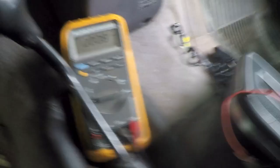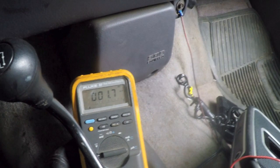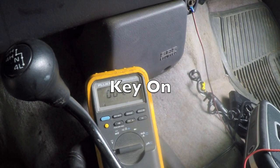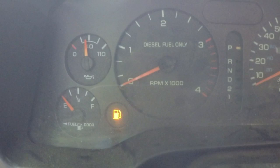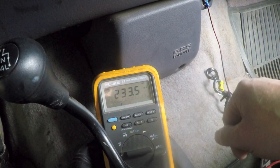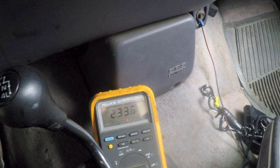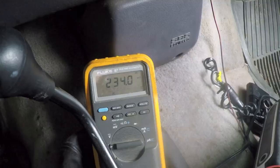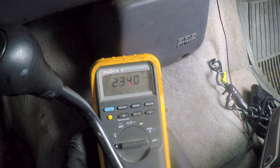I'm all connected up with the meter in the truck. Right now it's showing 0.8 millivolts AC — that's with the truck key off and not running. When I start the truck it comes up to about one and a half millivolts. The tachometer is not working, and now it's reading 233.6 millivolts — I notice this little indicator on the meter moving back and forth, which almost indicates it's seeing a pulsation. I'm wondering if that voltage will change as I change RPMs.